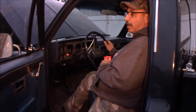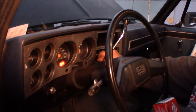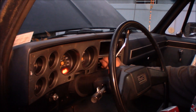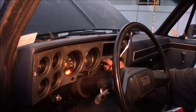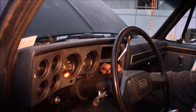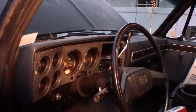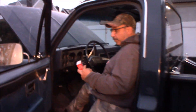Jumping inside to give you a little sound of what the blower motor sounds like — I'm on off, I hit one, I hit two, and I hit three. You can hear it's really blowing on high. It's got a little bit on one and two but almost nothing, so it's really not working. We're gonna put this in and that will solve our problem.